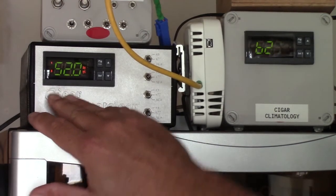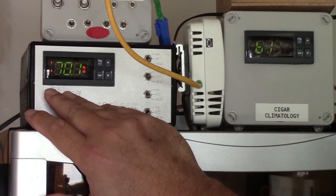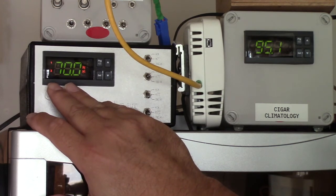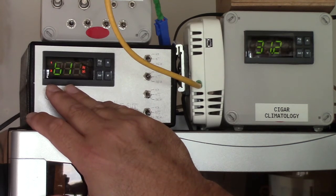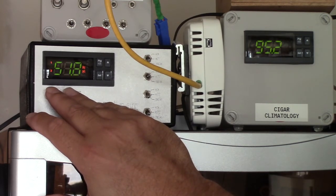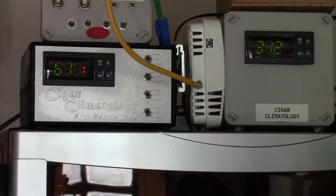You'll note in the time we've been talking it's taken a considerable period of time — this is a long run cycle for one of my coolers — to reduce itself from about 70.5 down to the 70 degree Fahrenheit mark. This cooling cycle is actually going to run so long that it will tend to overshoot the set point by a considerable margin, and to me a considerable margin is about one degree Fahrenheit. When you start talking about these types of swings in a cooler, this is still high precision to most people, but in my opinion it's lesser precision because you're working on the fringe edges as to whether or not a humidor is really working the way it's supposed to.